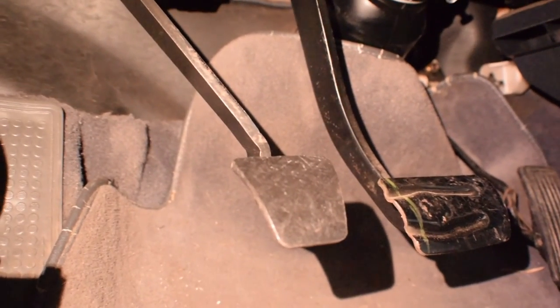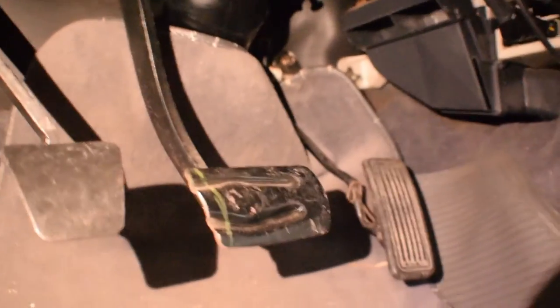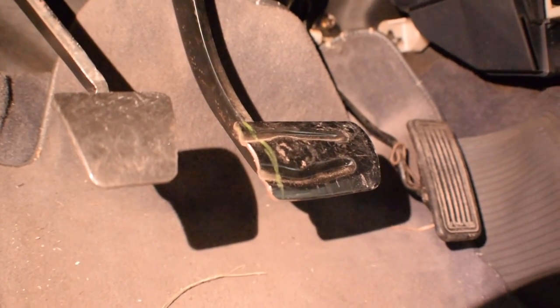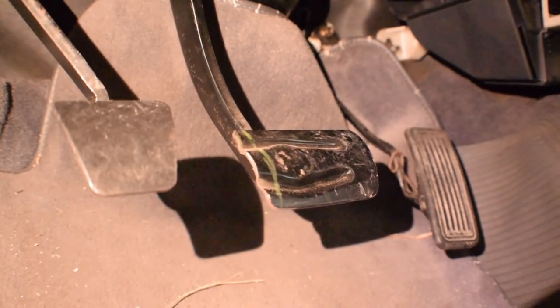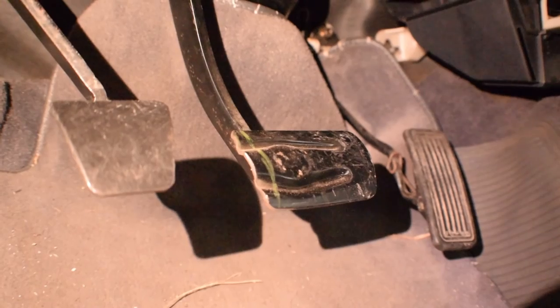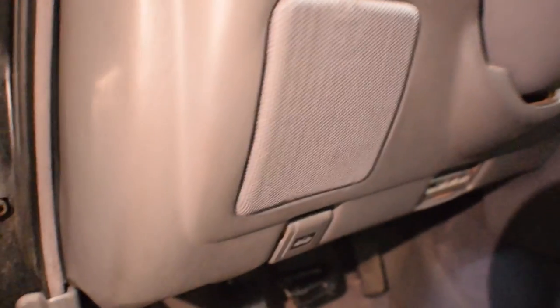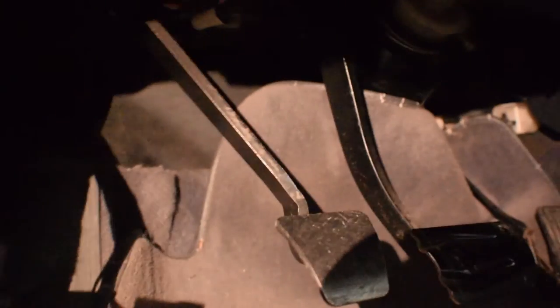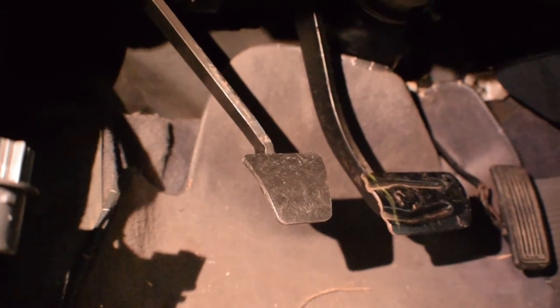This is the Excessive Manufacturing clutch pedal. When you install it, you're going to have to trim the brake pedal because it's too wide — most automatic cars have huge brake pedals, so you'll need to take it out and trim it up, or just cut it inside the car. To install this you're also going to have to take apart the lower dash to get to the bolt holes.